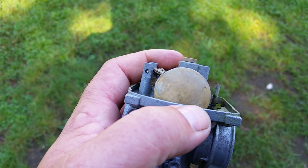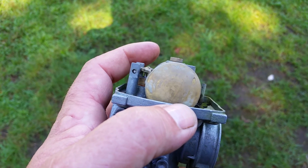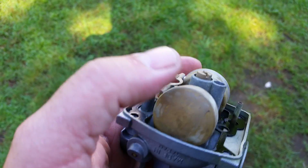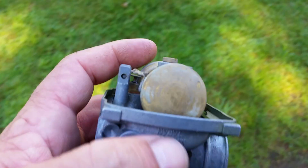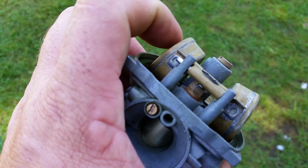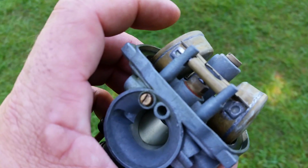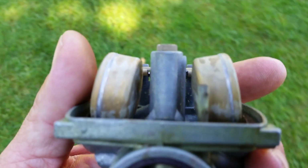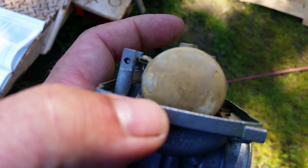I get it so it's nice and flat and level. So when the thing is all the way down like this, to full seat, I have a good margin, and when I let off of it, it's level. The float is level with this piece of carburetor right there, and I've never had an issue with it. You can do the measurement any way you want, but my carburetors don't leak, and they've always run great. There is room for the float to move up and down with that measurement. But some are saying to measure it from here.